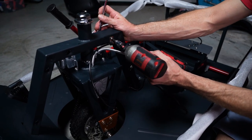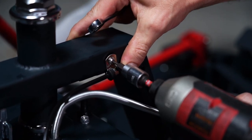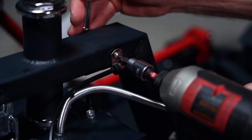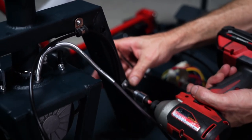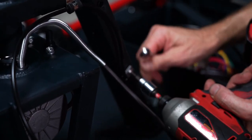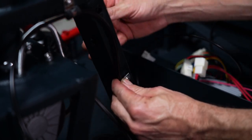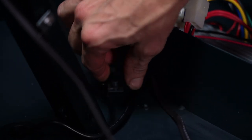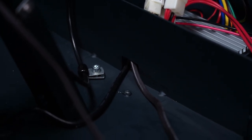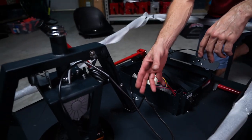Hold the clamp still while snugging the 8mm nut, then tighten the lower guide clamps. The 4mm Allen clamp at the threaded hole gets tightened completely. Now the front portion of the cable is set. For the motor harness, spin the fork 180 degrees clockwise, pull the harness parallel to the hydraulic cable — not super tight — and use the supplied zip ties to attach it to the hydraulic cable at two points. Pull tight and lock down, then flush-cut the zip tie tips and rotate them so they're hidden for a clean install.